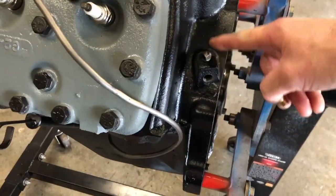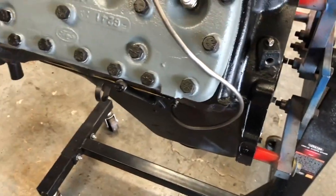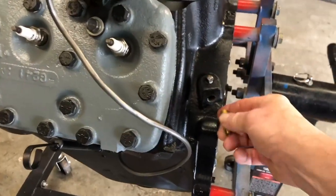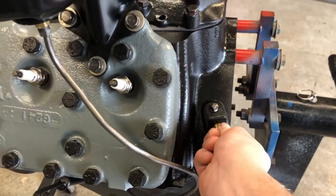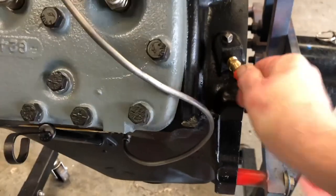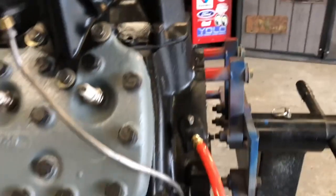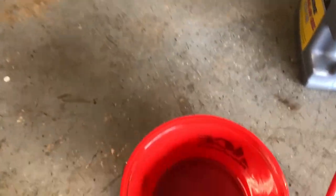I've got one of these at the rear of the flathead block. I have one of the oil passages blocked and the line removed from the oil filter down to the block. I'll put this air fitting into this oil hole. I've got one of these regular little pumps you can buy at any auto store, with the out part of the pump going to the rear of the block, and the end hose going into the oil.